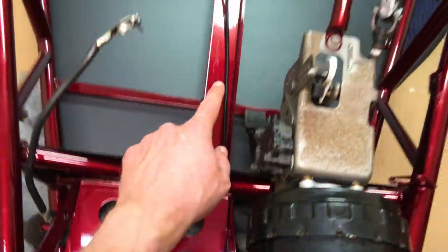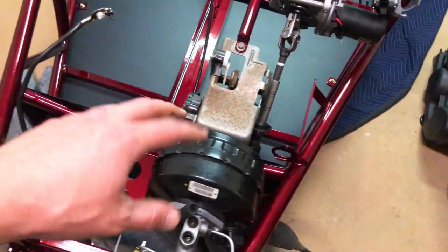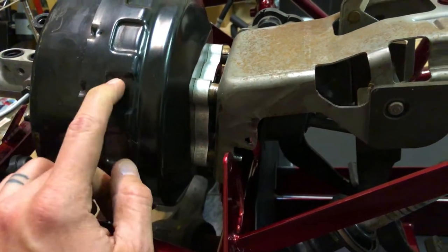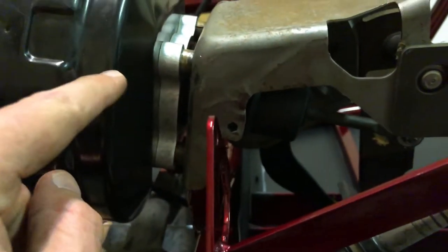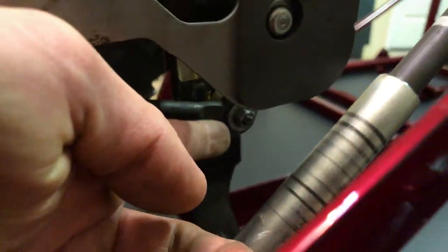And then that hose runs through the system all the way back to where the engine will sit, so that way you can use the engine's power to provide force for the vacuum system. And if you're wondering how the force is detected for the brake booster, there's a rod that goes through this system right here and is connected to the brake pedal.